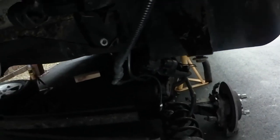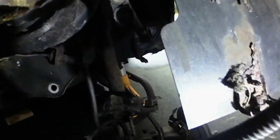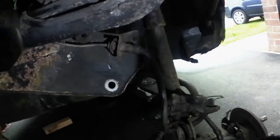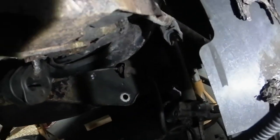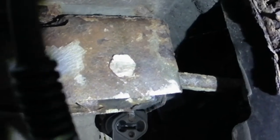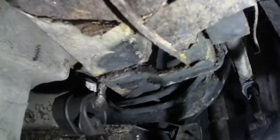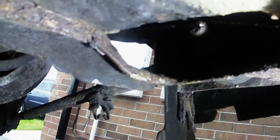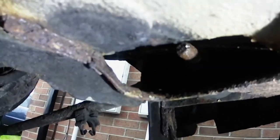So I fear I made a mistake on the rear suspension. This is it from the back, the rear suspension strut there. It's like a stabilizing point, and obviously the bushes on it are ruined. Now to get it off, I started cutting. You can see the end of the bolt there, cut to get it out, because it just would not come off. And I then managed to get the nut off on the inside, really difficult to see. There we go. And it left the bolt protruding.